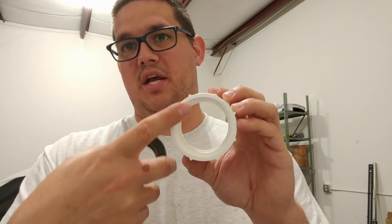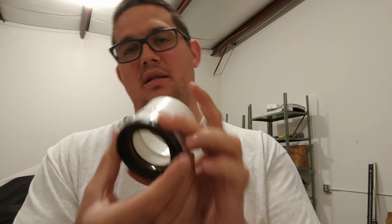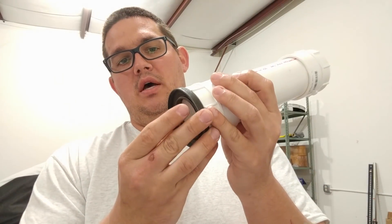The threaded one is a lot thicker, so when you're beating on it, it's a lot less likely to break. The only thing I'll tell you is last time I did this, the end cap — what you're hitting — I had to hit it so hard that it actually broke. So when you put it all together — this on that — that's the tool you're slipping over, and then you're going to hammer it. Stuff it with paper towels so if you do break the PVC, it doesn't shatter and go into your bearing. Two-inch PVC fits perfect on these seals to drive them in. I'm going to give it a shot, and if I can't, I've got one more trick but I'd have to remove a bracket off the truck — I really don't want to do that.